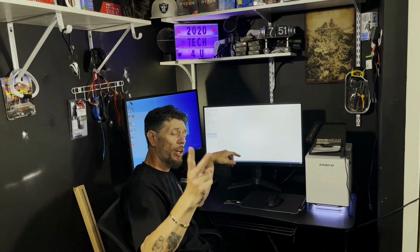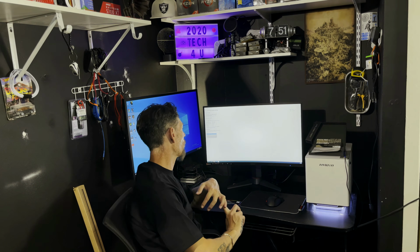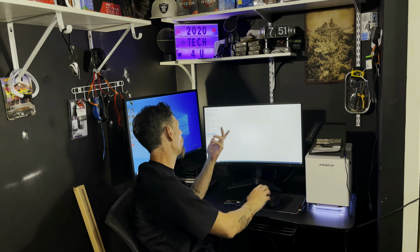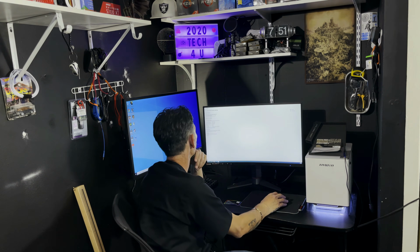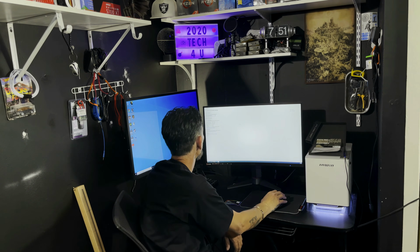So what you want to do is open this up and take it down, and right here you'll see you have 2 other choices. You have 119.871, 143.995. So we want to put it on the highest it could go. Big difference. So I've never used a 144 Hertz panel or higher before, so it's my first time messing with this, and I thought I'd, as usual, bring you guys along for the ride. This monitor's been sitting in this corner for about a week now, and I've been really eager to set it up, to start using it, but I'm gonna have to make a video.